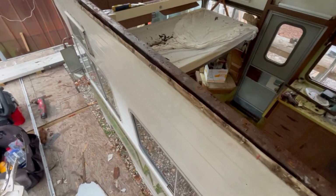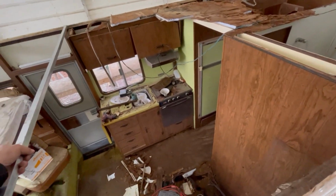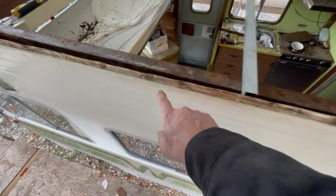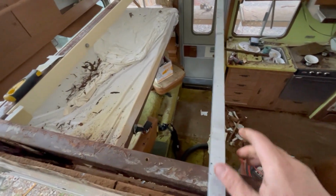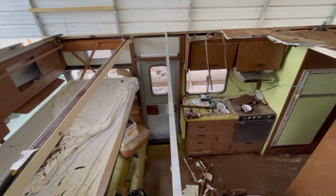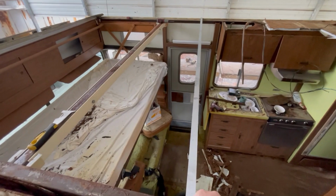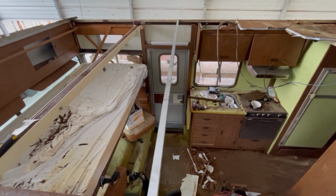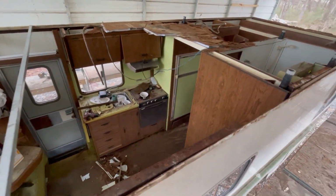And then I've got this 1x1 aluminum square tubing that once we get all the boards put on there, I've gone through, and you can see where I've marked these every 16 inches. So I've got enough of this to go across the whole span, and we're going to respan once we get the board on here and we put the ceiling panel on. Then we'll respan all that with this every 16 inches, and that way we put our plywood on, we got ways to attach it there.